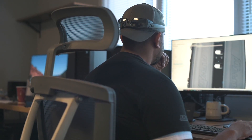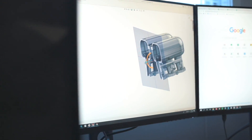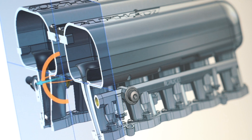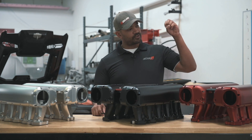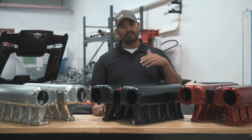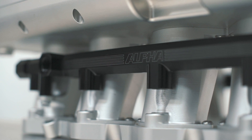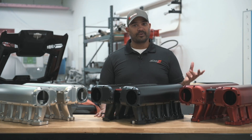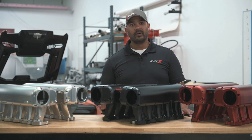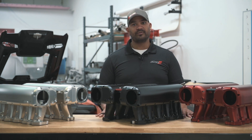It's got a DFI injector — an injector that sprays fuel directly into the combustion chamber. It also has a port fuel injector which injects fuel about 60–70% of the way down the runner, so you have two streams of fuel being mixed by the air and pumped into a pretty precise location. These are meant to work with either the stock rails or the new Alpha rails, which do work with both the stock manifold and this manifold — so plenty of fuel availability for this setup.